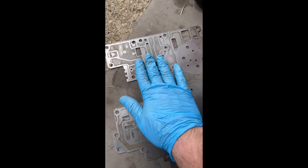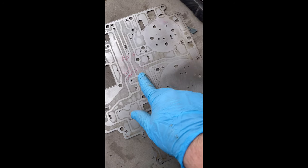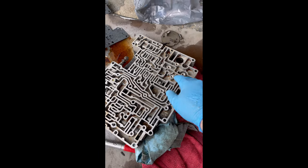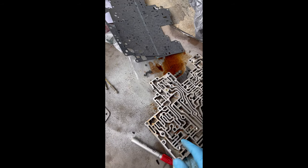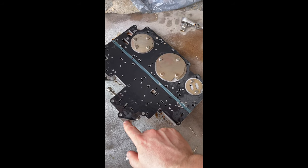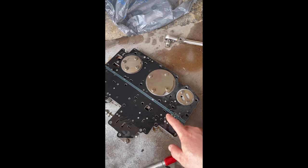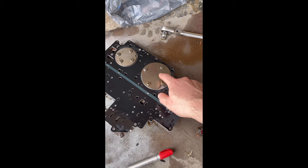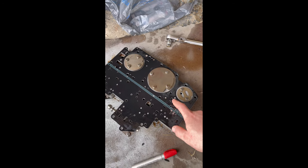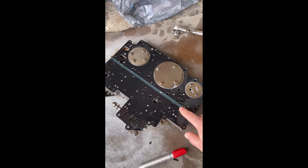All right, now we have them all drilled and everything's cleaned off. I cleaned it with some Scotch-Brite because there will be some corrosion or buildup on here — transmission fluid is just a high-detergent oil so it may leave some stuff. Not a big deal as long as it feels good and flat. Now, reassembly with the check balls — make sure everything's cleaned, all your passages. Here's your drain back valve, your screens and filters. Also, a little trick: put some fresh trans fluid on the gasket so it'll hold down in the corners — they like to pull up and it helps keep it seated so it won't move around on you.